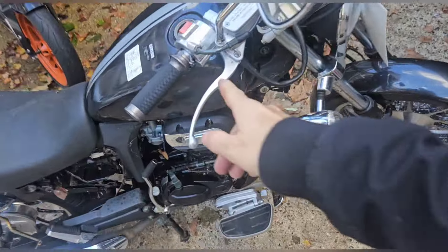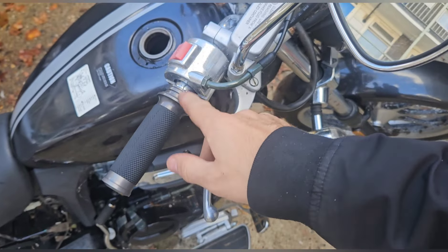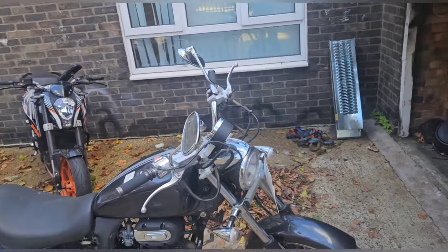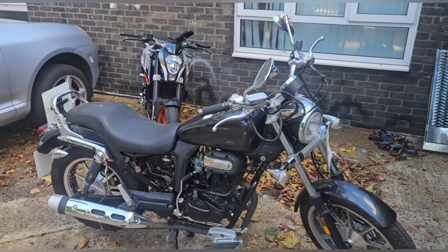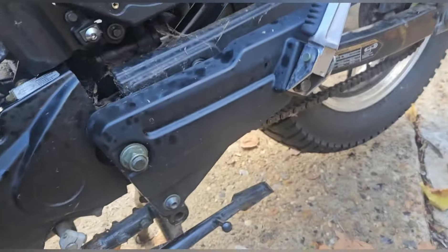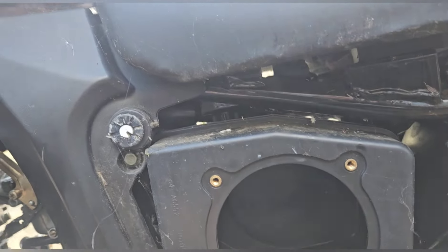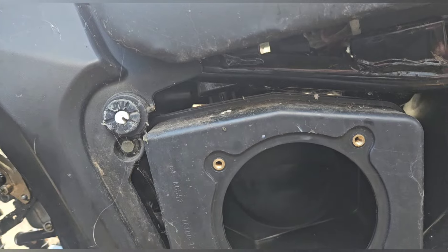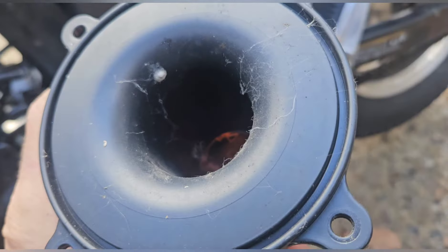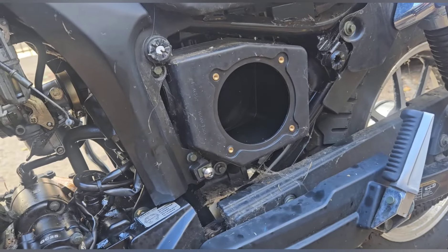I've just noticed something weird — look up here. Why is this out of the housing? I'm going to have to pop the housing off. It's either just slipped out or someone's messed with it, but it's not right and we won't be able to run it. The bike was on its side — probably its right side — so you have to check the airbox because oil could have come up and sat in there. Air filter is brand new, looks great. Oh — spiders. But the filter's great so that can go back in, and there's no oil in there, so I'm happy with that.